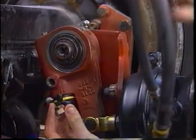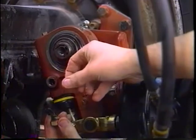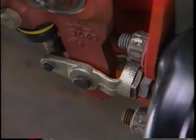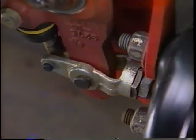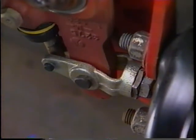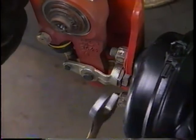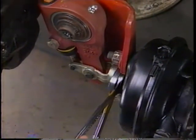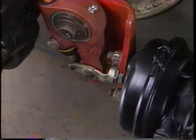The pawl assembly could be damaged, so remove the pawl and check for wear or grease contamination. If a quick connect collar is used, check for excessive wear between the clevis and the collar using a gap gauge. If the gap is more than 60 thousandths of an inch, replace the clevis and the collar assembly with a threaded clevis. Check the jam nut on the push rod. If the quick connect collar is loose, it could shift the slack adjuster angle out of spec, causing a problem